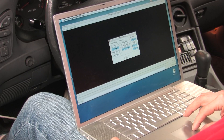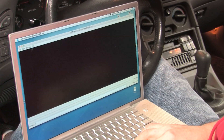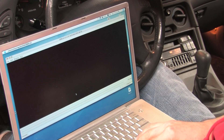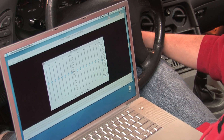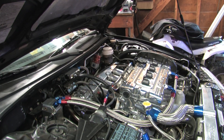Prime the fuel system and check for leaks. Clearly something's wrong. I've got a misfire — what it sounds like, but what it most likely is, is either a bad injector pulse signal, a clogged injector, or a burned out injector.